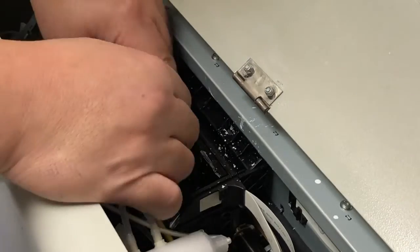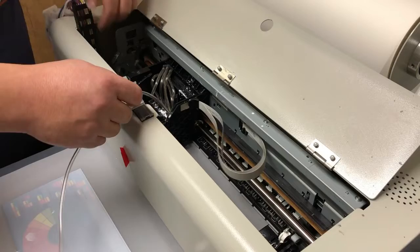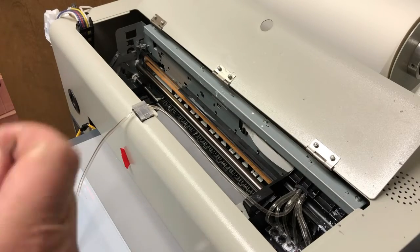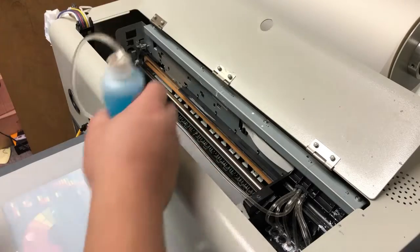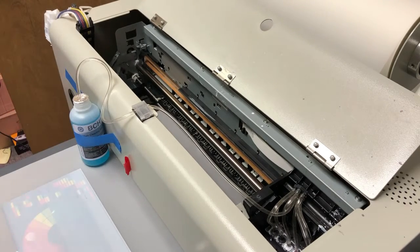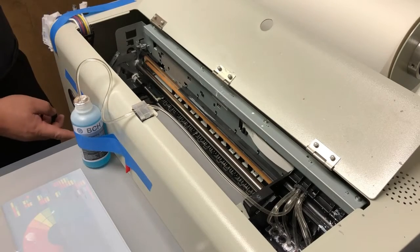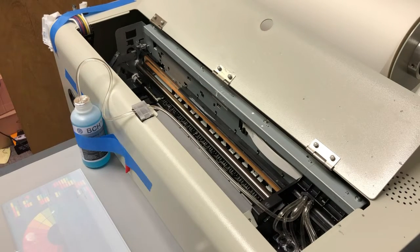Now I'm connecting the six tubes from the printhead to the six outlets on the manifold. I take the two-feet tube and connect it to the middle. You don't need a clamp, but it just makes things look nicer. Now you can put this side of the tube in the cleaning solution. I usually poke two holes just in case, so the tube isn't airtight and the fluid can come out. You can put it on the side and tape it up, or you can put it on top — either way it works. Do not let the cleaning solution sit in the printhead for a prolonged period of time. You cannot fill the printhead with cleaning solution and just leave it — you have to wash it out.